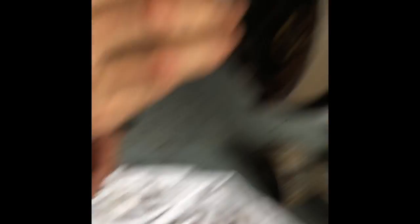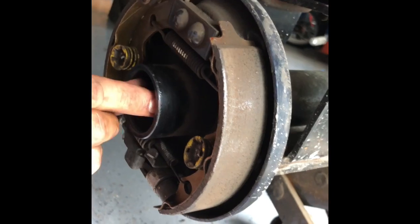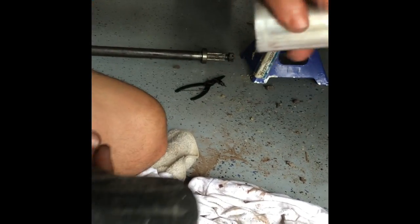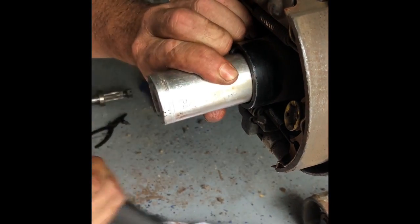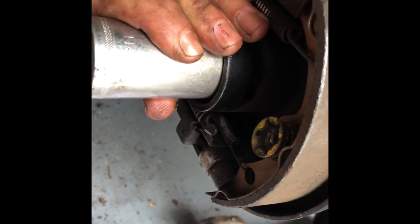Get the next piece of the kit — we got to put that seal in. The seal's got to go in this way, flat. What I like to do is just run my finger in here to make sure there ain't no metal, then slide it in nice and smooth. Take your little hammer and a socket that'll fit it. You got to hit it back until it's past that groove — two grooves, past the second groove. Make sure you're in there nice and even. Look at how pretty that looks in there.